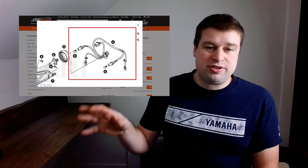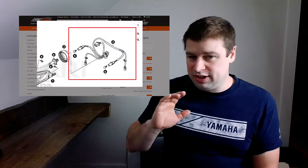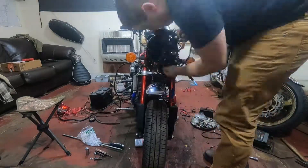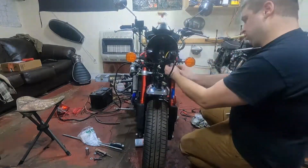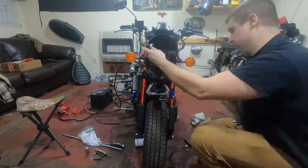The lights are obviously different. You need to make sure you have the lighting harness for the CBR in order to make it work. I got rid of the stock headlight and I'm running a seven-inch universal Daymaker headlight — black background, really nice. It throws out a lot more light than the stock headlight and it's running on an H4 plug. If you're going to make the harness work for your monkey, you're really going to have to play with what wire works correctly and what doesn't.